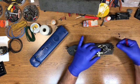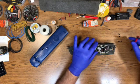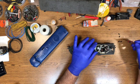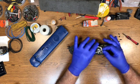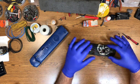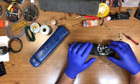There's one brush here. Ooh boy, that's nasty in there. Look at that. That brush is stuck, and it's all caked up. It's got all kinds of carbon buildup on it. It's pretty gooey, it's sticky. See how black my finger is. Okay, so anyway, that's pretty dirty. So we're going to clean up. Now see, this is a double wound magnetic coil. That's the reason for the green wire and the copper wire color.